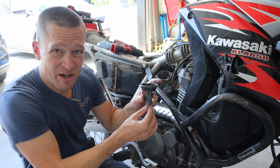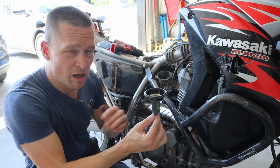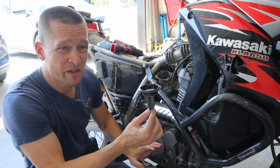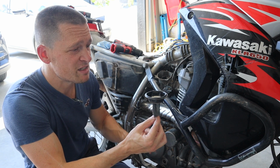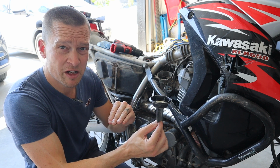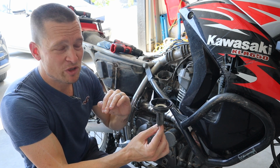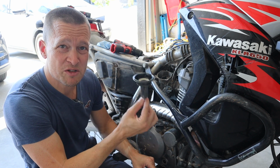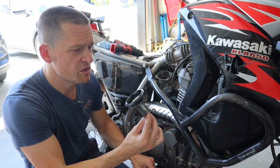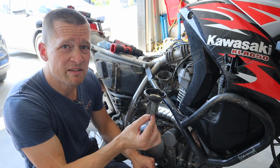And that's basically how a CV carb works. It works independently of the throttle, completely independently. Later, fuel injection bikes, like I think my V-Strom, the Suzuki, actually simulated this with a second throttle valve. So even if you pinned it, the computer would keep the velocity up by slowly opening that thing. And that's essentially copying what this old school technology was doing all along. So that's about as good of an explanation as I can give.